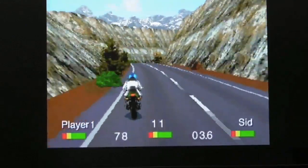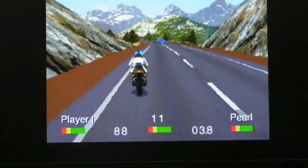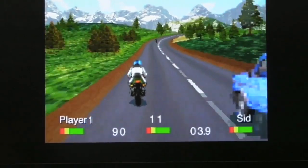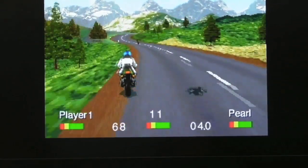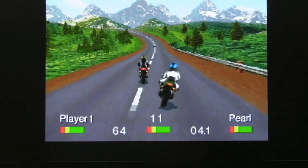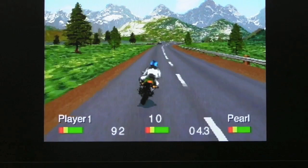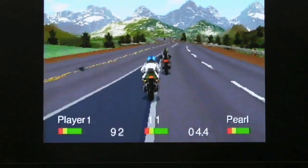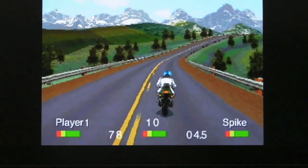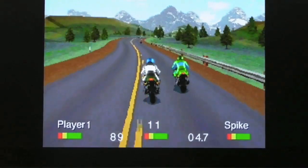As you can see, it's working fine here. It's been on for about 20 minutes now with no sound problems at all. So first instance: if you're getting weird problems with your CD drive — crashing, lock-ups, not reading discs, and sound issues — check out those caps on the power supply. In my case, the 10 microfarad cap probably sits on the higher voltage line — maybe 9 or 12 volts — that feeds the CD drive and also goes to the audio output stage, perhaps the op-amp, which is typical in these systems.